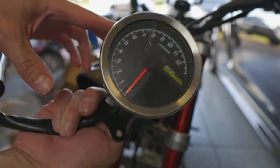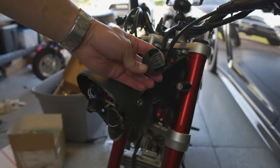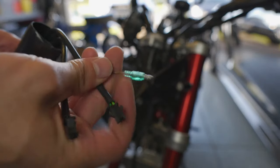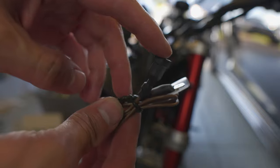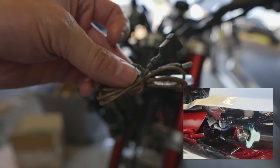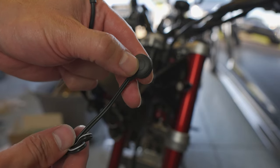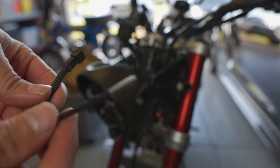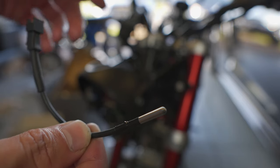On the other side it has one plug for the original harness, and it also has two accessory harnesses and a single pin for the RPM read. The kit comes with a pass-through that goes to the negative terminal on the coil and has the correct plug that runs up to the headlight bucket. One accessory is a push button to control the settings — it comes with a piece of tape so you can conveniently mount it on the bike. The other accessory is an ambient temperature sensor; you can apparently buy a kit to route it to your actual engine temp sensor.